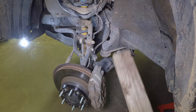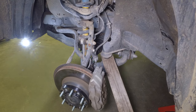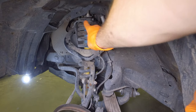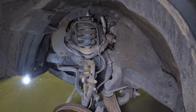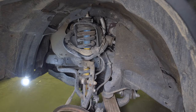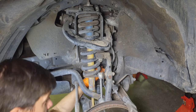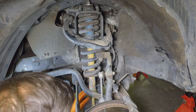I'm going to shove a piece of wood between the bump stop and the lower control arm and use that as a fulcrum to push down on the lower control arm — probably going to use a foot or a buddy to help. You can see how that moves the whole suspension; since we undid the top bolts, it's pulling the whole spring and everything down. One thing I want to point out: make sure you're not shoving the wood all the way back into your CV boot. Make sure you have plenty of room so when you fulcrum it, you're not going to collide.